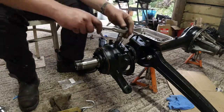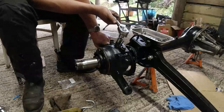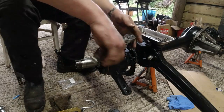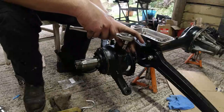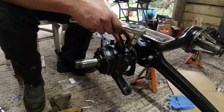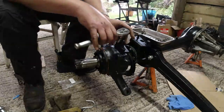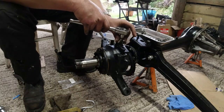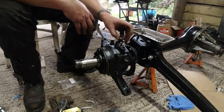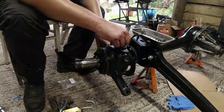We're quite a long way over, so what I might do is add another really fat one in. You can see why this becomes a pain — they did it really nicely up to... Obviously if your torque wrench has got a reverse on it, then fine, do that, but mine just doesn't work quite as easily as that. Now what you'll find is, as you start getting closer, you may find that you only need a tiny shim, so I'm only going to add a couple of tiny shims in next to see what happens. The screw on the top here is actually quite useful because it helps you pull the swivel pin back out again.